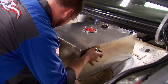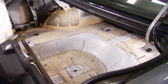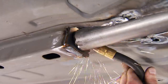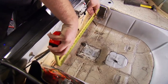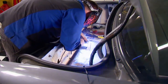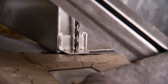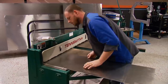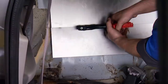While Mike finishes the headers, John's getting to work on the fuel delivery system, which now includes a Jazz aluminum fuel cell with a sending unit — and would you believe it, more modifications. Earlier in this project, we removed the factory fuel tank to make room for our custom-made subframe connectors, along with a horizontal bar for reinforcement. To mount the cell in the trunk, John first welds in a couple of support plates inside the spare tire well. After cutting a piece of tubing to length, he secures it to the top of the plates, then welds a couple of smaller plates to the bar. The fuel cell's mounting tabs bolt to them, and the other tabs simply bolt to the floor of the trunk. Inside the bird, John takes some measurements for sheet metal pieces that serve as a firewall between the fuel cell and the car's interior, held in place with pop rivets.